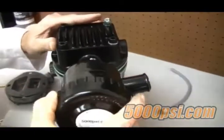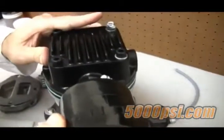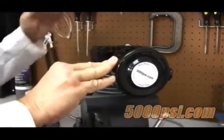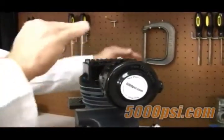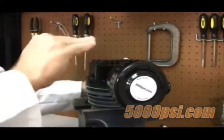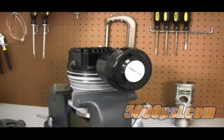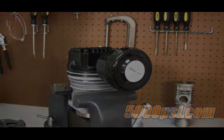Now all that's left is to reconnect the tubing, reinstall the breather tube, and the intake filter. One final warning before you start the machine: rotate the flywheel all the way around to ensure there are no obstructions or interferences with the pistons. Run the compressor briefly to see that the first stage comes up to full pressure and is otherwise operating properly. For breathing air, it's always prudent to ensure there are no dangerous fumes being pulled into the intake.